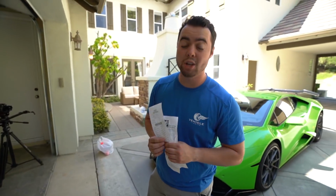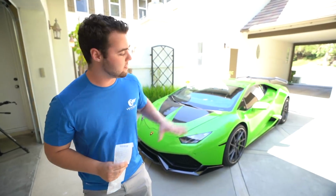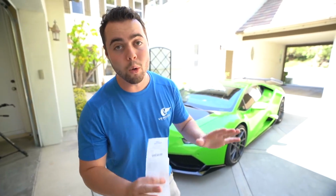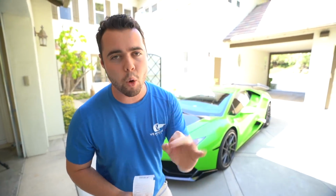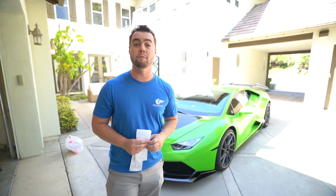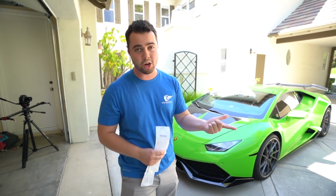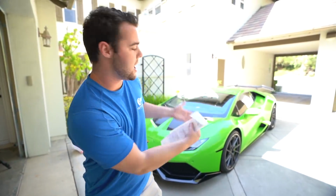All in all, I spent $90 on this. Now, I only got 3 cans of PLASTIDIP, and I'll tell you why. For one, this is a Lamborghini, which is a lot smaller than your typical car. And two, for the purposes of this video, I'm only going to be PLASTIDIPing exactly half of the car. It is very important, however, to have thick layers of PLASTIDIP, but before that, it's even more important to make sure the car is clean. If you have any dirt and debris, not only are you going to scratch the car when you remove it, it's also not going to create as good of a bond to the paint so that it lasts for a while. Let's wash it.